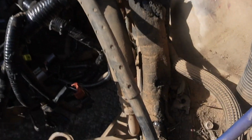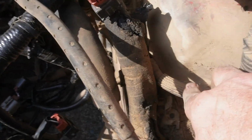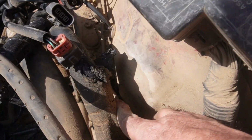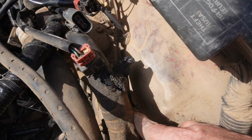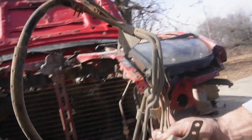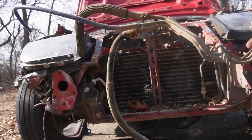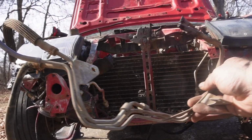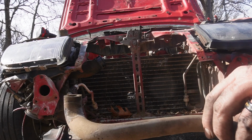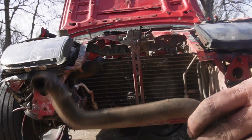So part of that triple line connects to this braided fuel line right here. I'm trying to get it. You want to disconnect this part right here and take this fuel line out, because you're going to connect it later. And guys, this is the line that comes off of your carb canister. This hose also goes into the frame of the car.